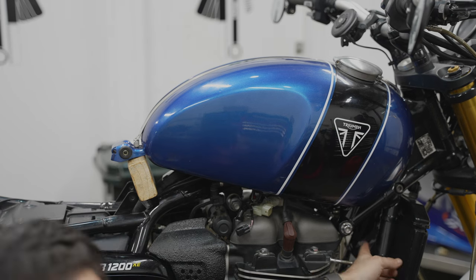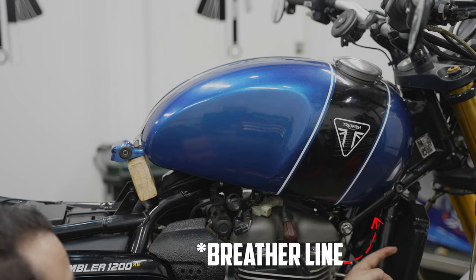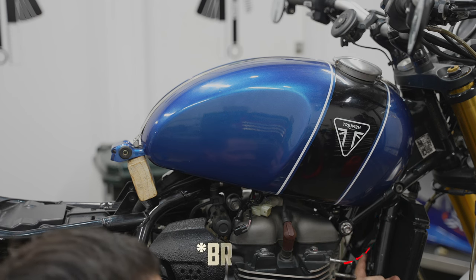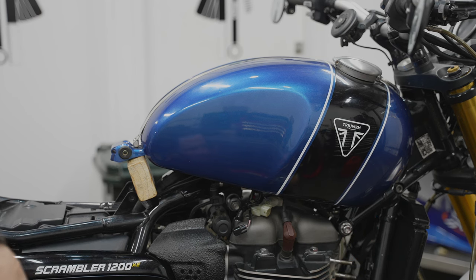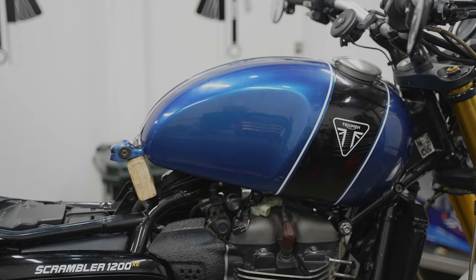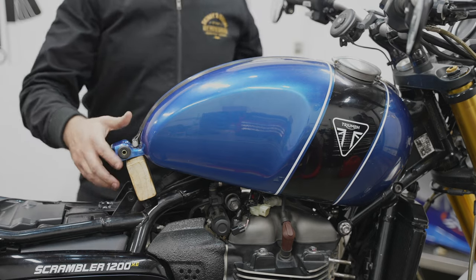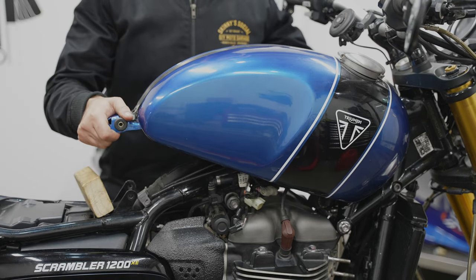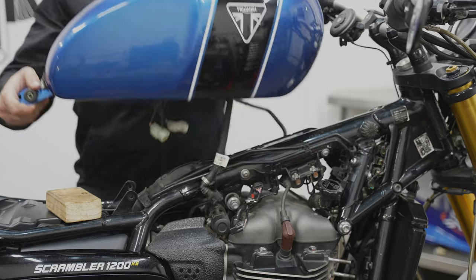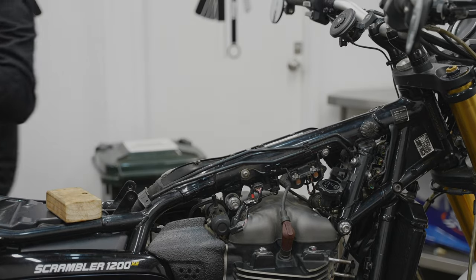The last little bit will be up in here. There is a little fuel line that you'll just need to pull a hose clamp off. Once you've done that, if you get quick at it, it can be like 15 minutes and you can lift off the fuel tank - piece of cake.